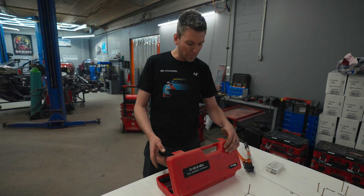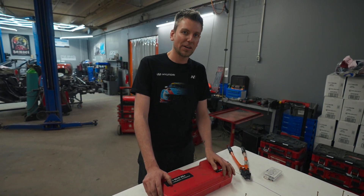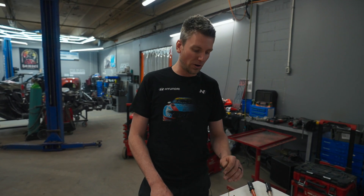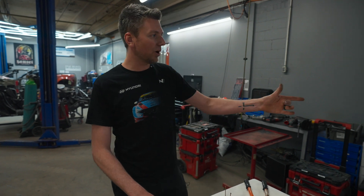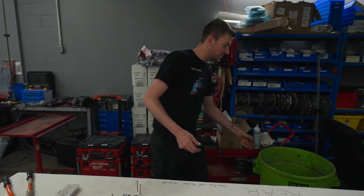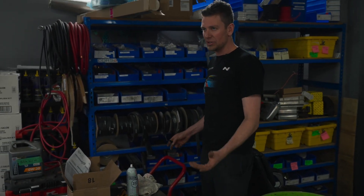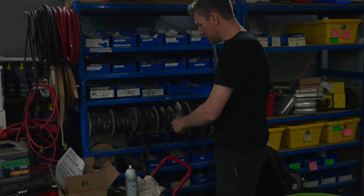Some people like to solder, but I'm not really a huge fan of solder on cars because the solder will wick up the wire and create a fragile breaking point, especially in an area where it's moving a lot. A barrel crimp will not cause that fatigue or stress point in the wire. So always try and use a butt splice and then use proper heat shrink — we always use heat shrink that's got the glue inside it. Just the simple glue-lined heat shrink over your battery cables keeps it nice and reliable. We've been doing battery swaps for 15 years now and haven't had any problems.